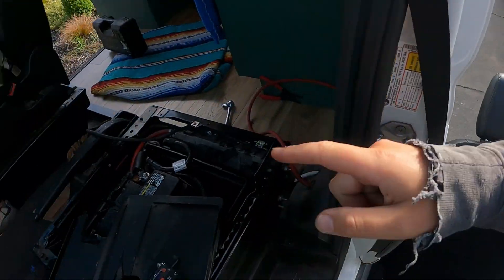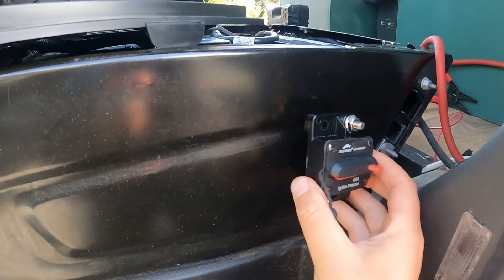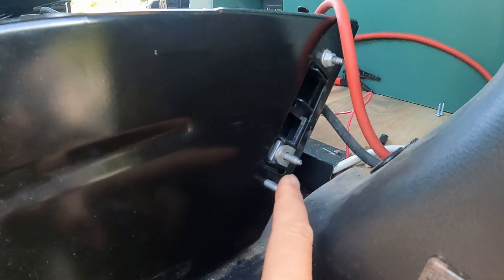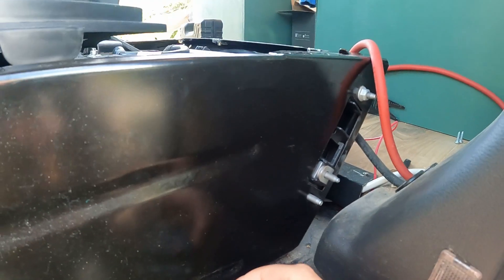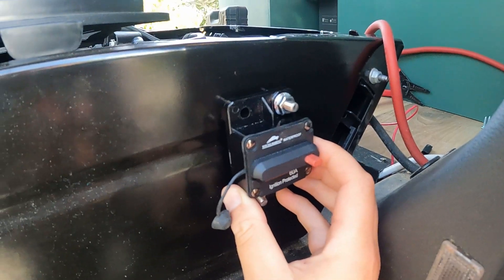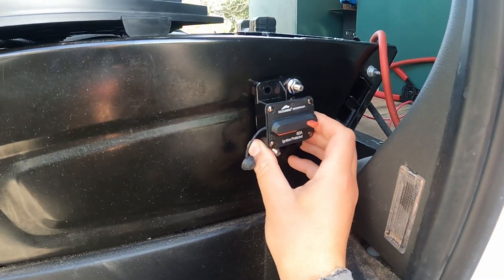One of the last things we need to do to our van is hook up our DC to DC to the battery and put the D plus signal in. We have to take out the front seat, so that's step number one. We have a 60 amp breaker that is going to act as our switch as well because it has a test and reset. This is your CCP, customer connection point, and that's how we're going to power our DC to DC. I'm going to mount this right here via some sheet metal screws, and then we'll go to the next step.